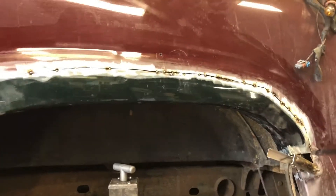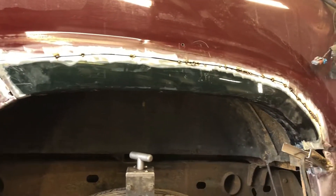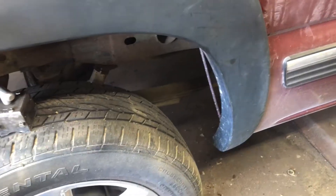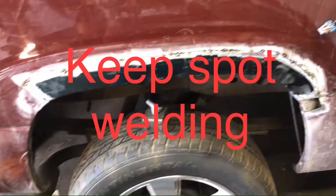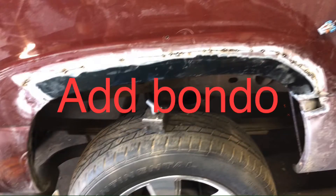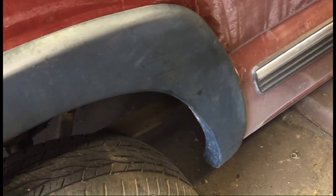Kind of hard to see because of the green, but if I painted it you'd see it better. For support — look, nothing shows. Finished doing all the spot welds, then go into the bondo, and the finished product: sand, prime, paint — it's on its way.